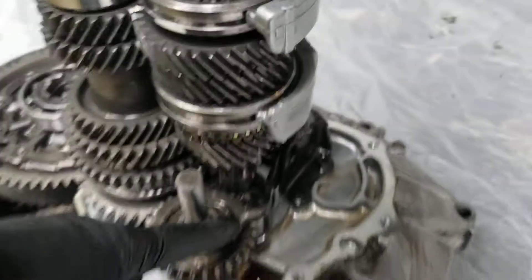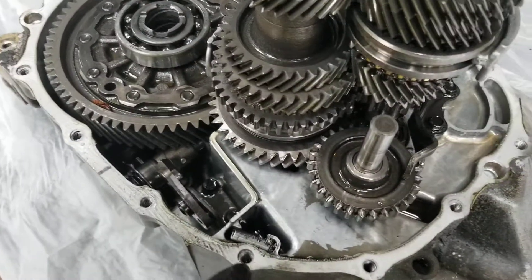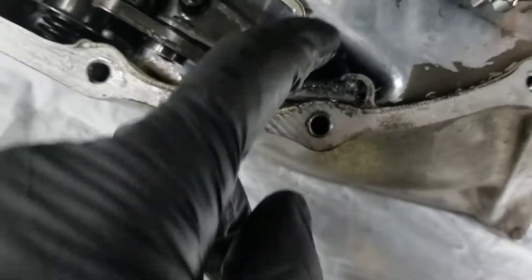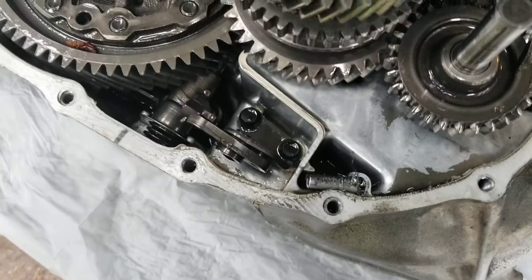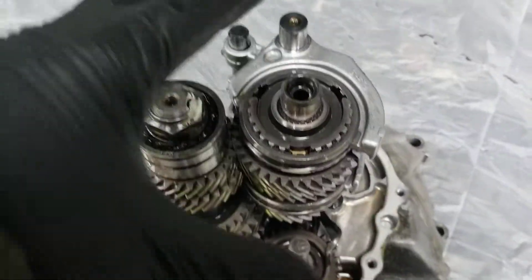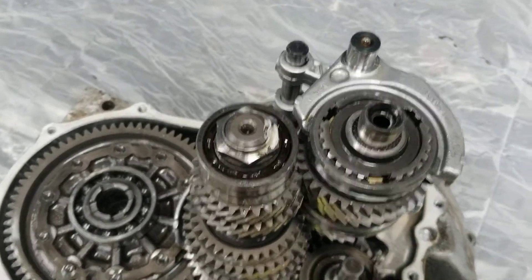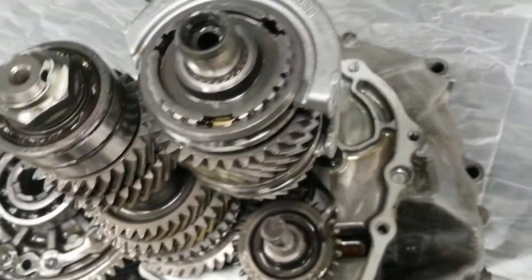This is the reverse — everybody knows it. It's nice and clean. I don't have to leverage anything. That's the magnet — the magnet is always a good sign for inspection. Mine has some very light metal particles on it, which is not a secret. Yesterday when I cleaned the cover, the bearing sitting right here — man, it was busted, just gone. I'm not surprised why the gearbox was a little noisy.